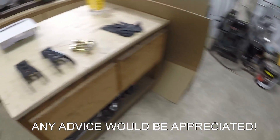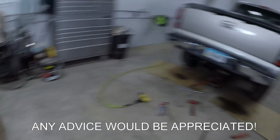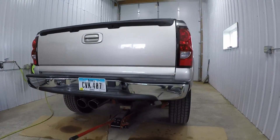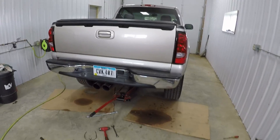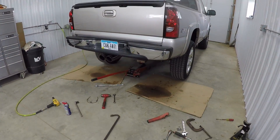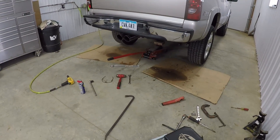The lowering shackles are going to have to wait. I did get some new bolts - I thought maybe I could cut the old bolts and use new ones - but the top two go through a bushing in the leaf spring, so those will have to come out no matter what. So we'll have to wait on the lowering shackles. I'm just going to put it back together, get it outside, and do another little walk-around and go over all the other stuff I did this winter.